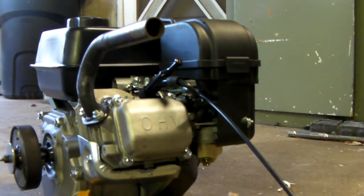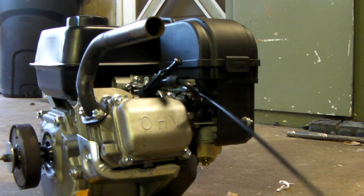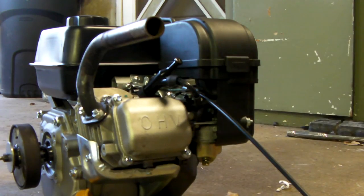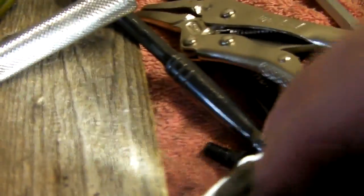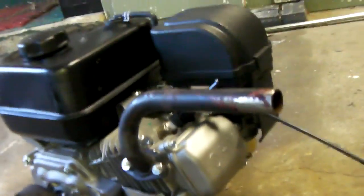Hell yeah, thing fired right up! It actually sounds a lot better — it's more responsive. At this point I've only put the valve springs in. I'm gonna move on now to the air filter adapter, cone filter, and the carb kit which consists of a main jet and a pilot jet. I'm going to show you guys how to put those in, and that'll be in the next video. The valve springs definitely made it seem a little snappier right out of the bat.